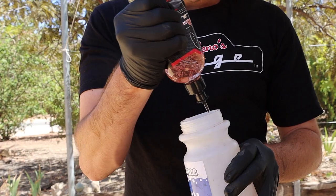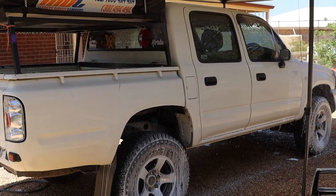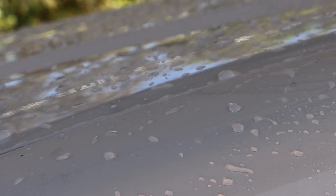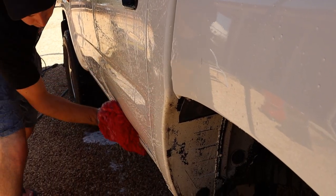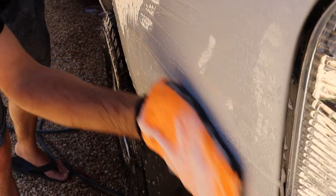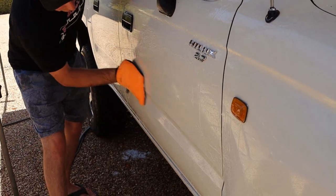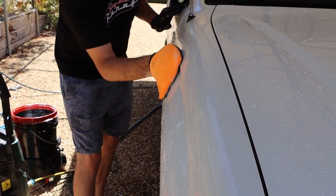Clean strip in the foam cannon wasn't a necessary job but still helped in aiding for a safer wash, helping to break down the immediate mess. It wasn't overly thick but to be fair I didn't use that much as I knew I'd be using it again immediately after with the wash mitt. When using it with the wash mitt, it felt slick under the mitt and when it came to rinsing it off, it was also a breeze. It left the car with very little beading ability as it did have protection previously added, and this is the one time where we want to be having none at all. The clay mitt offered a more thorough cleaning stage. These new methods in claying are super easy without sacrificing quality of work. The clay mitt was a dream to use, speeding up the usual slow process and due to its shape and flexibility, it was also easy to get in and around those hard to reach areas. It's also good for up to 40 washes and if you were to drop it, unlike having to throw it away like you would with a clay bar, you can simply rinse it down and continue working.